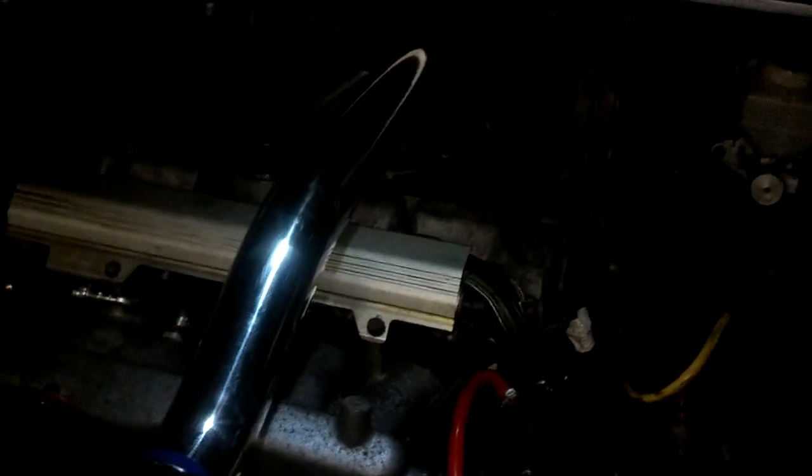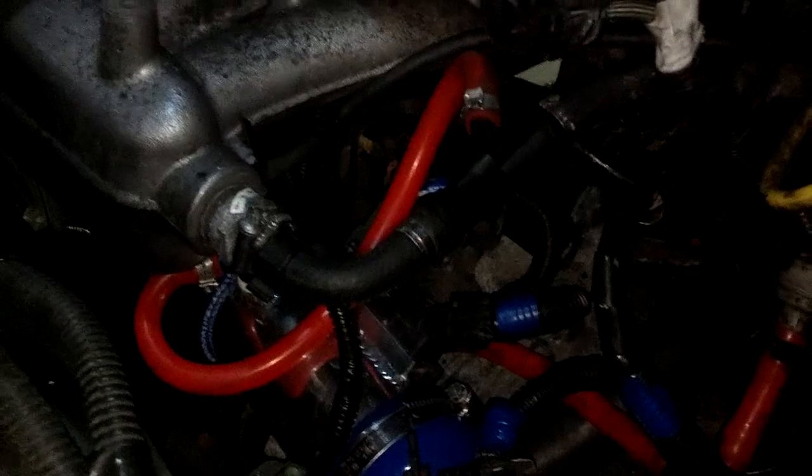Took a dinner break from working on the car, but as you can see, the RIP kit has been installed. That's the reverse intercooler pipe running over the engine. The pipe going down to the bottom of the intercooler has been installed — it's a snap system. There's some silicone tubing. This guy has a manual boost controller to control his boost, and the computer has to adapt to whatever boost he has dialed in. We still need to put the air box in. Since we cleaned out the PCV kit, we're going to change the oil, flush the coolant, and he wants to replace his heater core.